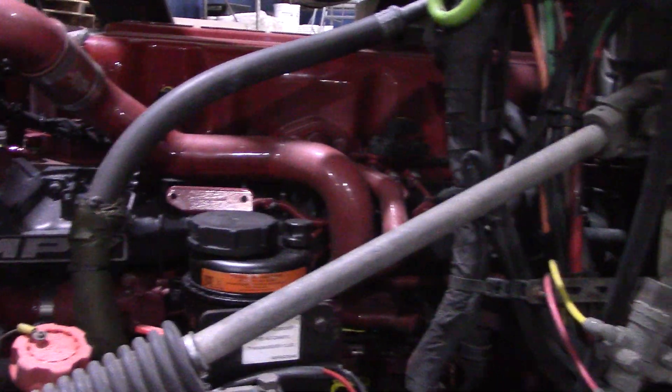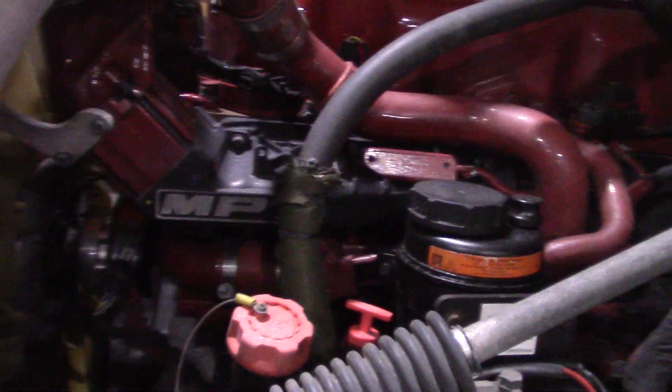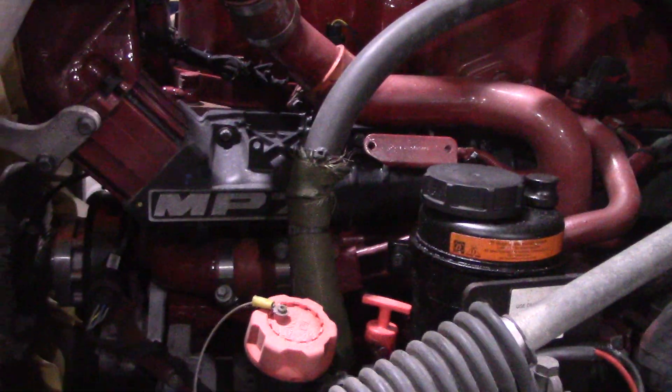This was an engine I went over last year with the harness, EGR core, cleaned all the pipes out. So that's what I found with this one. I hope this helps — just if you run into codes like that with a harness open, I always recommend just take a quick inspection. Look for anything obvious, anything rubbed, anything that looks out of the ordinary. And that's usually going to be your culprit, before you go ohming out wires and stuff like that.